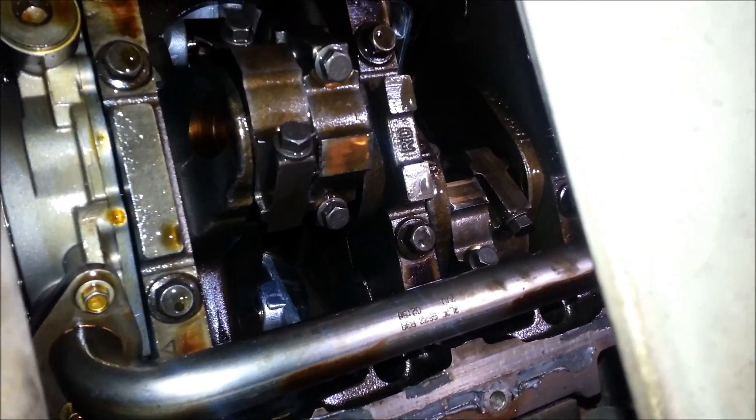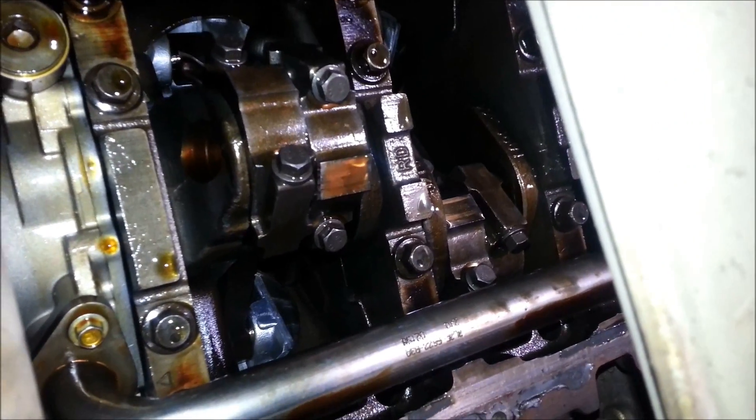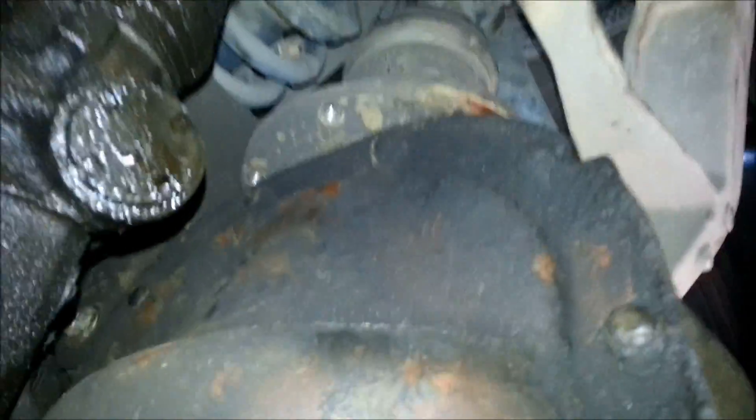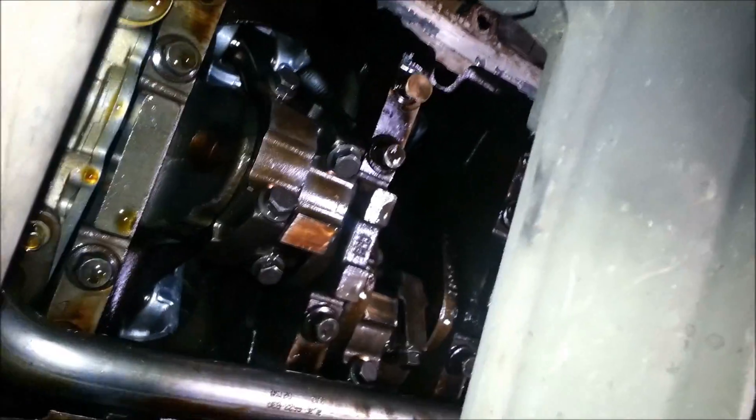Expeditions are hard to work on, but luckily with this car I was able to pull the oil pan off right there with it still in the vehicle. As you see here, the front axle — I dropped it on this side, I had to take it off because it was hitting the suspension. So on both sides I took it off. I took out two bolts so I could pivot it on the third one on the top. I pivoted it down and slowly worked the engine oil pan out.